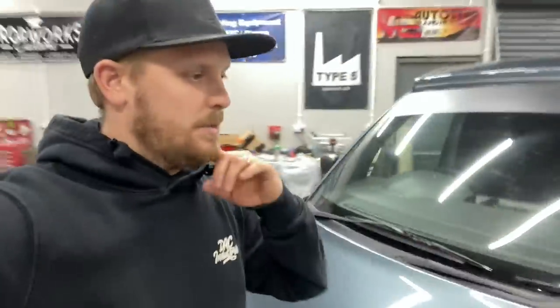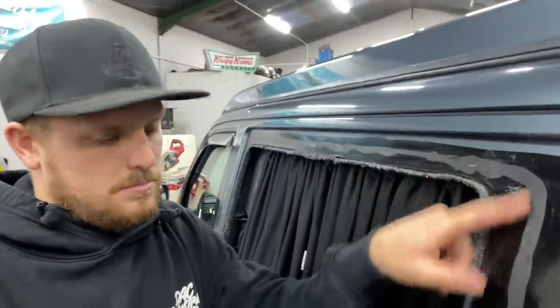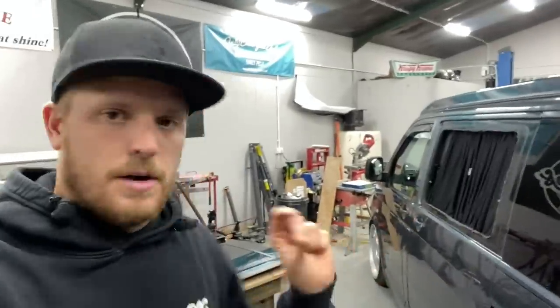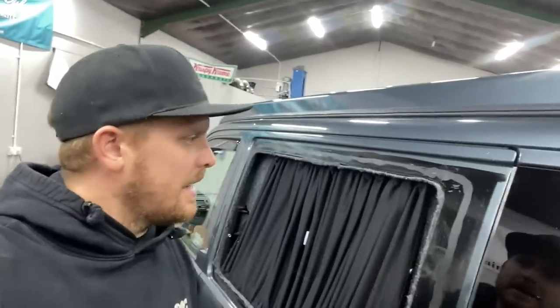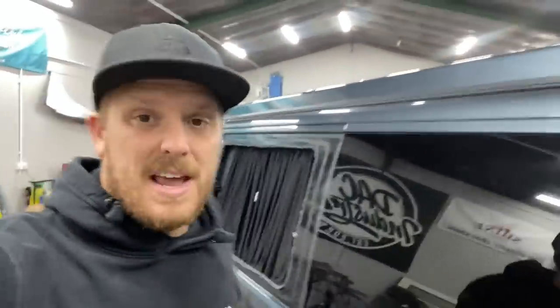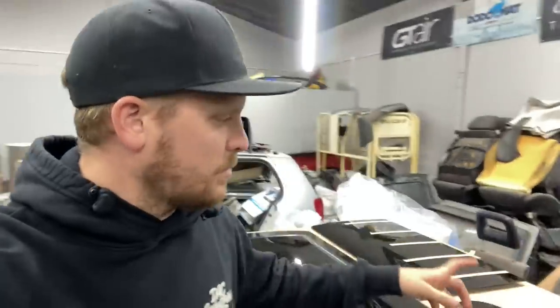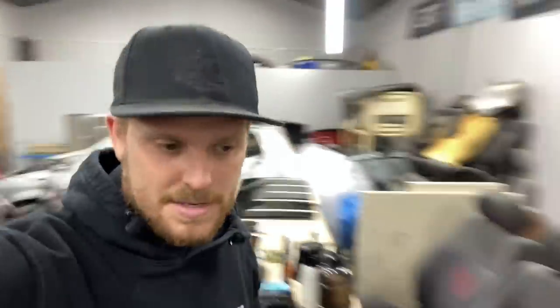It's the same process as before. I missed a step - I went round with blades and a wood chisel, which was the sharpest strongest thing I had since I haven't got single-sided razor blades. Single-sided razor blades are the best thing to clean off the old adhesive - get it as flat as you can. Now we need to prime the van body and the back of the new windows. We also need to heat up the adhesive because heating makes it come out of the mastic gun easier.